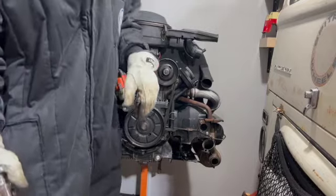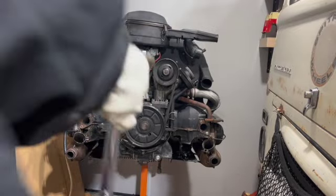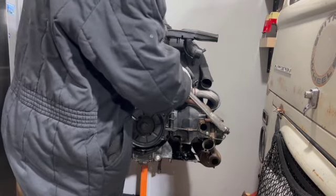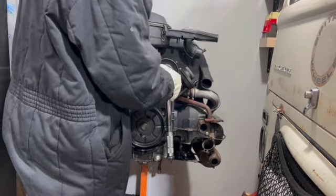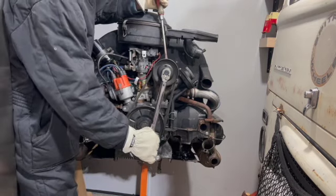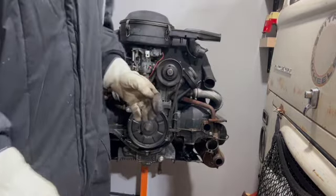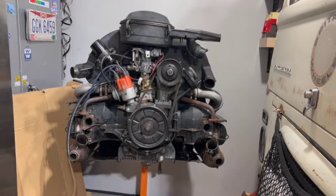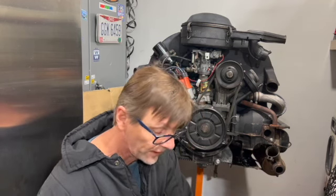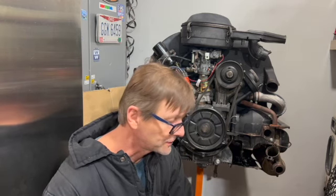And then we got to get our screwdriver. I left it somewhere. Here we go. So we got to find our sweet spot. And this one I'm going to torque to 40 foot-pounds. There we go. That's pretty good. And that's all we're going to do with that engine today. We're just going to push it to the side. And that's it. So, well guys, unfortunately I didn't get to install that today. It's really cold in this garage right now, and I don't feel like working anymore in here right now. So that was pretty much it.